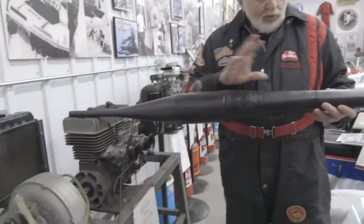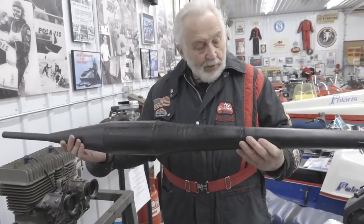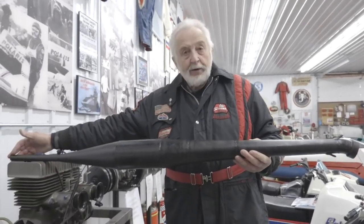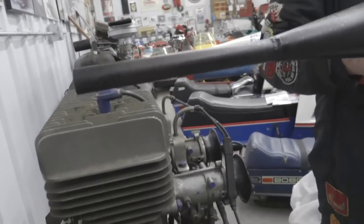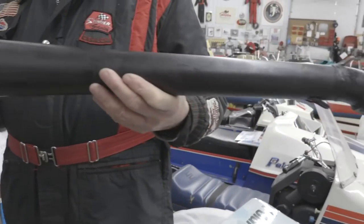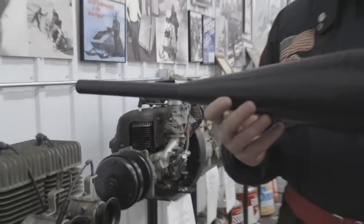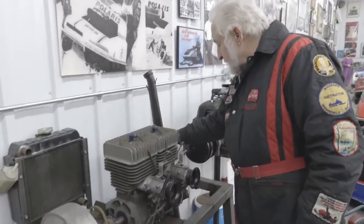Once they get the ideal horsepower, then they start cutting it and putting it in the snowmobile. But first it's always this, even in modern technology. Now they do a lot on the computer and it can tell it too, but this is the basic of what it is. Then they put a silencer on out here to quiet it down. But this is the pipe that makes the horsepower. A lot of it still comes from any two cycle and even motorcycles and everything else. This is how we make more horsepower. How we design this stinger pipe is how we get how much RPM we can run, and we want to make it not too radical so that the clutches will clutch and power the snowmobile.